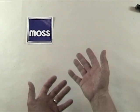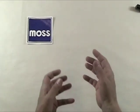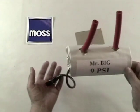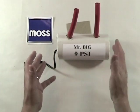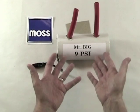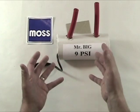Plus, the pumps they offered didn't operate at any sissy 3 pounds per square inch. Their electric fuel pumps produced a whopping 8 or 9 pounds per square inch. They were made to feed the big Holley 4-barrels and their kind. So the guy selling the non-SU pump would say something like, "These are great, I got one of these in my boat."